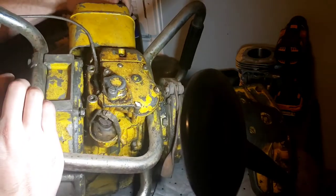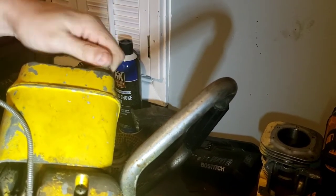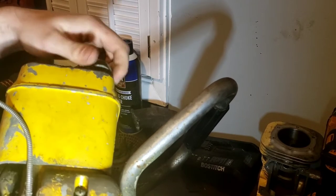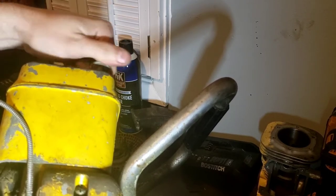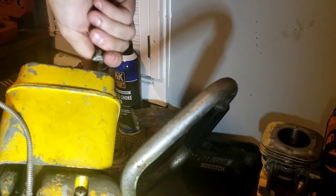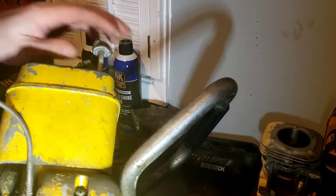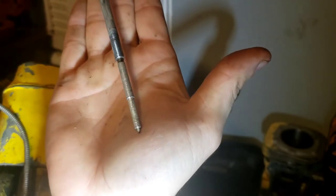Take the fuel valve up on top up here, and we're just going to unscrew it out. Before, I didn't know that. There's a set screw right there, so you can readjust its final position. That's how you shut your gas off. You meter how much goes into it and adjust it on the fly. This is your fuel shutoff needle. In quotes, needle. The needle.